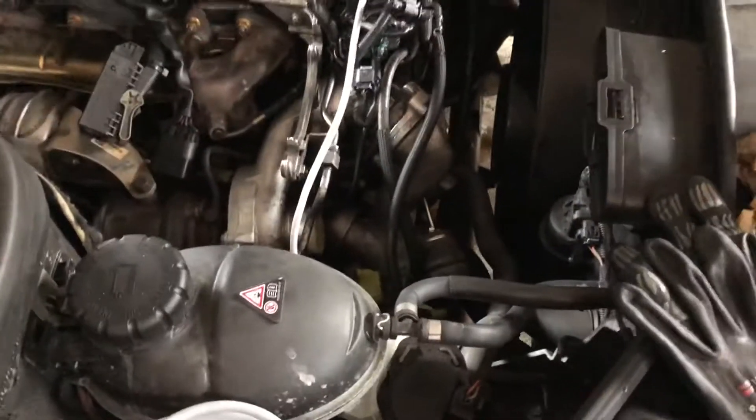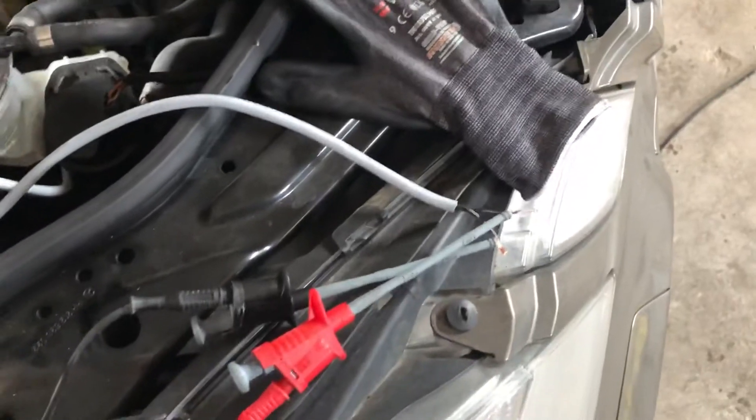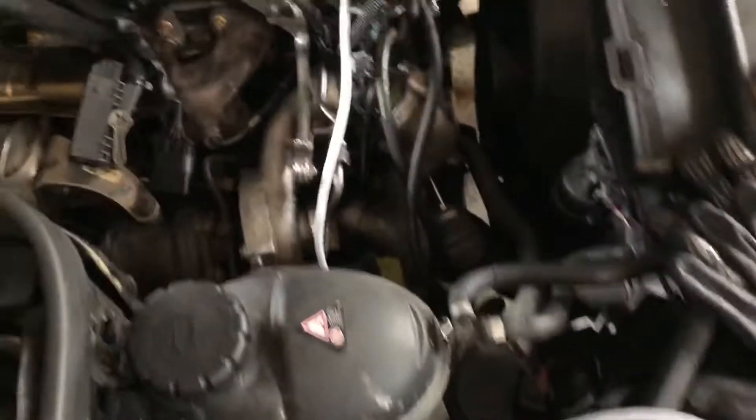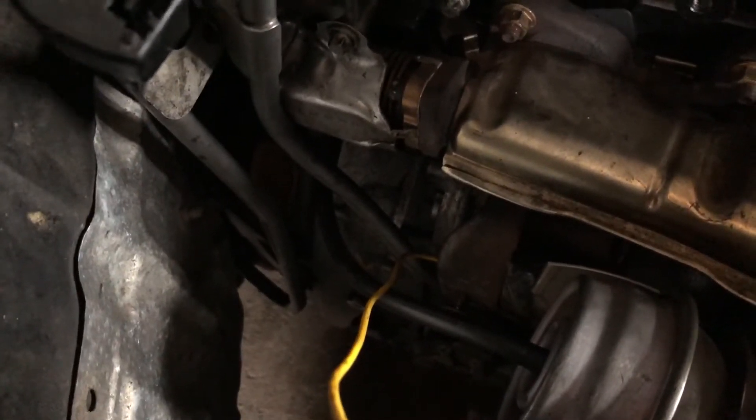For testing purposes, instead of going out and buying a gauge and everything, I just hooked up my multimeter to that. While I built the engine, I did hook up this yellow wire here down to the starter solenoid so that I'd be able to run the starter off of that instead of having to pull fuses or whatever for the lift pump of the diesel system.